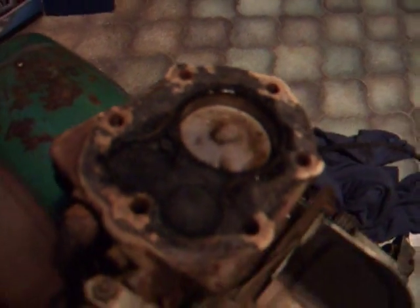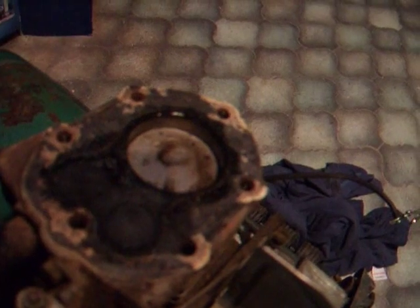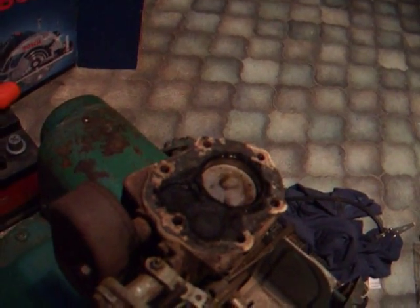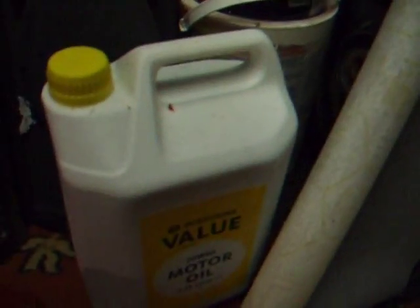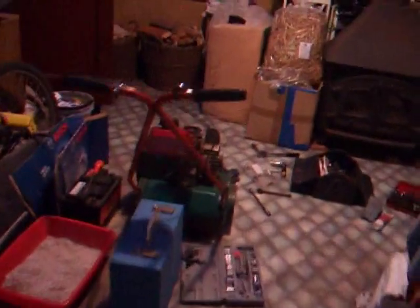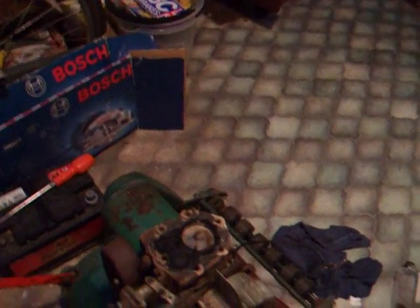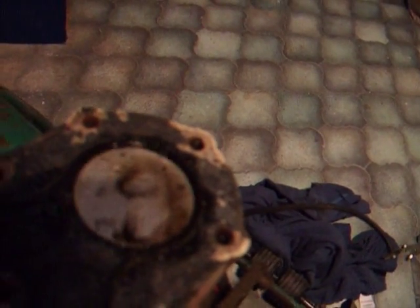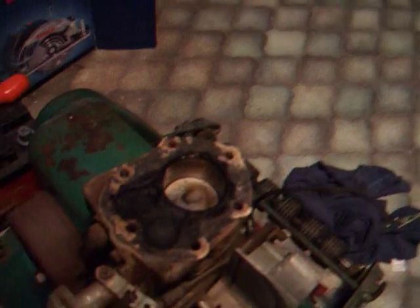There's a build-up of carbon and the valves are pretty carbonised, so I'll clean all that up. I'll probably drain the oil and do what Mr. Motor Kid suggested - run it on some Morrison's 20w50 oil, see if that stops it from smoking as badly with some thicker oil. If any luck it will. The bore looks fairly good - it's not too bad, so it's probably just rings that are gone, rings are worn.